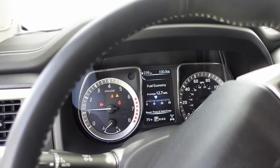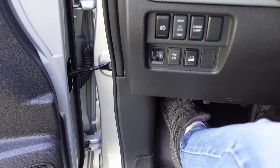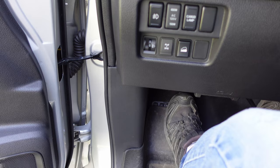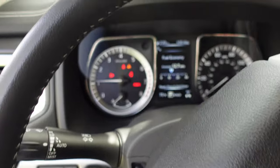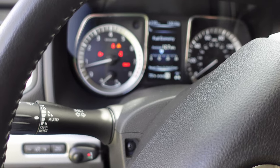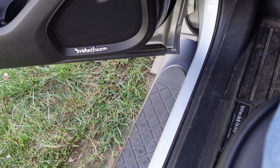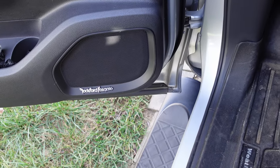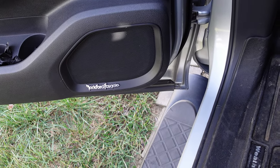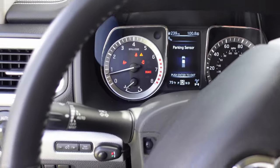With the truck running, we'll clear that error. We're going to go ahead and try this out now that we've made a slight adjustment. We push that down — now we feel some tension right as we get to the bottom of it. It does feel tight, but we're able to have full travel. With that depressed, we're now going to put the vehicle in drive and watch to make sure it doesn't roll away. It didn't move at all — just about an inch. We'll put the vehicle in reverse for the same test. Vehicle moved only about an inch, and that is just gearing and tension related. We are secure.